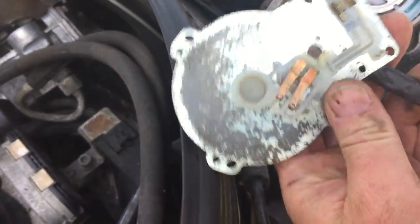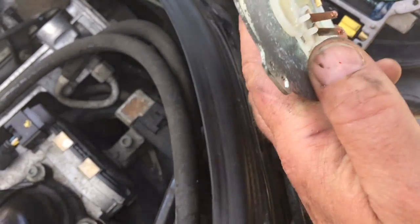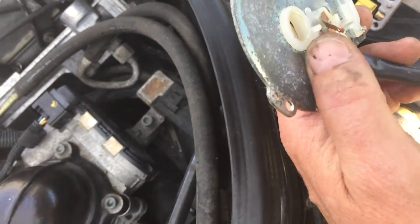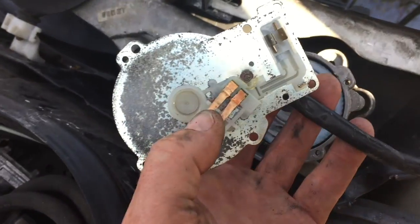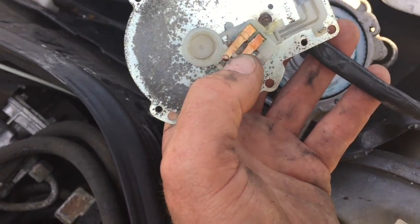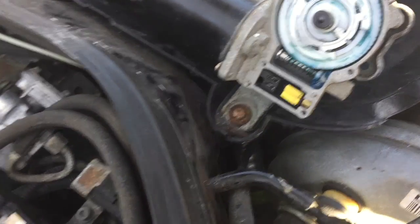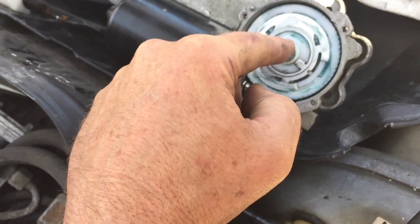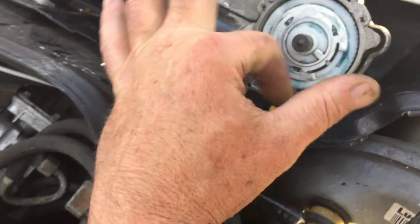And now, you're going to look here, and here's the two contacts for the motor. I bent these slightly downward. You know, they're up like this, they're spring-loaded. I bent them slightly this way, but they were coated in the grease that's in there, and they were also all black, meaning that it's basically carbon tracking over the years. This was all blackened grease from the wiper moving back and forth over the years. It's slowly sanding and sanding and sanding.